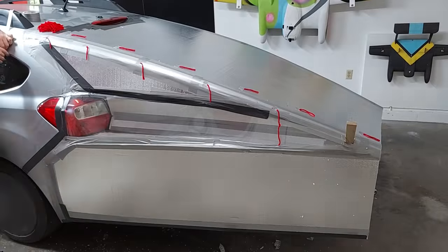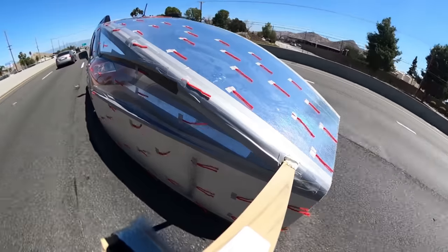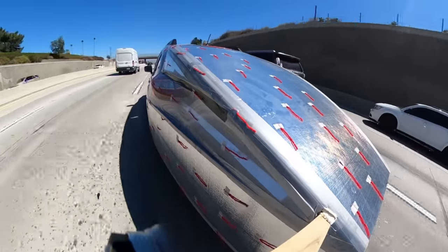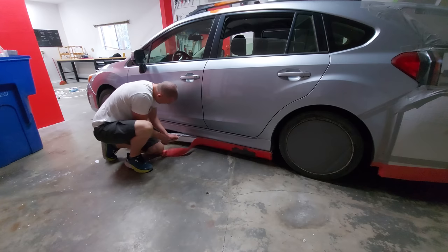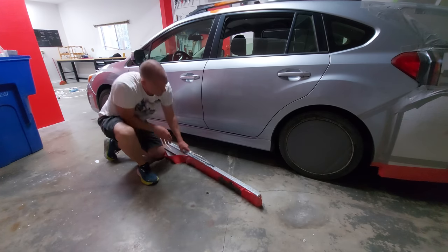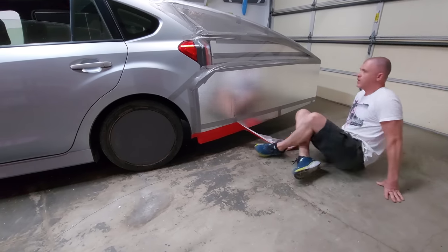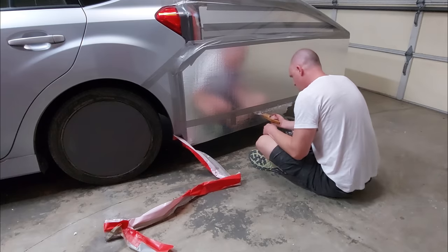It was back to putting tufts on the car to get an idea of what the problem was. The tufts on the top were laying nice and flat, and I may have been able to slope the tail down further and still get good airflow. The tufts on the lower sides and tail light area indicated somewhat chaotic airflow, but not nearly as bad as the original tail. This is a confusing result, as the gas pump indicated the new tail is much less efficient than the first tail, but the tufts indicate otherwise. This makes me question whether basing fuel burn on how reliably the gas pump fills the tank to the same point each time is a good method — perhaps there are other reasons. Leave a comment if you have an idea.